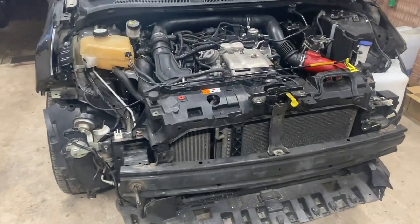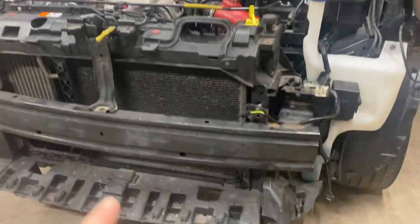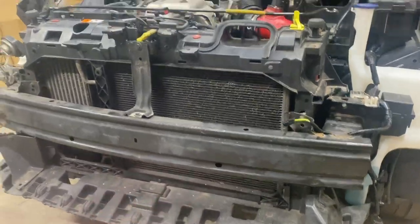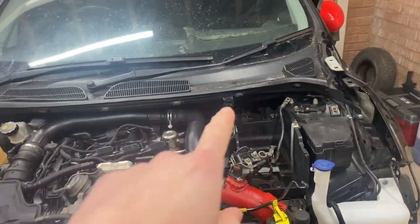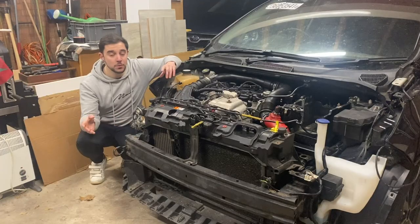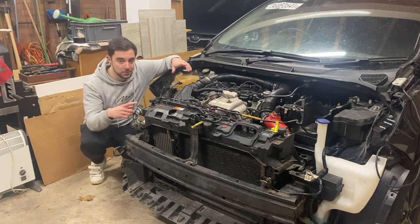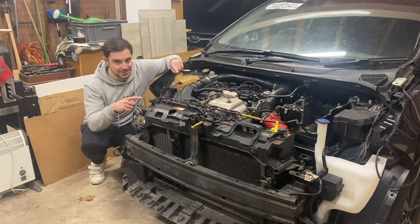We're about 90% done — just a couple of bits of wiring underneath for the fans, fill up with coolant and engine oil, fit the battery, and then we're ready for the first start. With the rad pack back on I've reconnected the radiator and intercooler piping, reinstalled the header tank, reconnected the fuel rail to the high pressure fuel pump, and fitted all the intake piping and air filter. The first start video will be out next week — let me know in the comments whether you think this car is going to start based on my diagnosis and the work done throughout this rebuild. Hit subscribe to join me next week and find out!